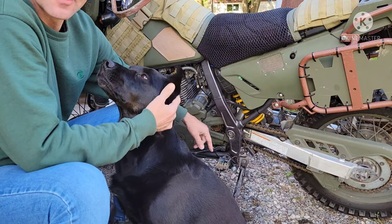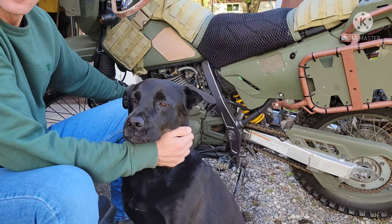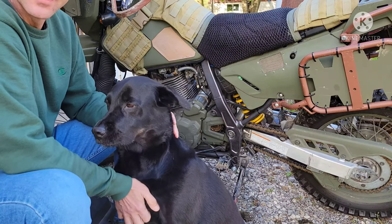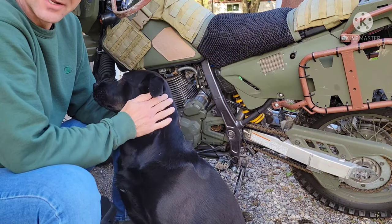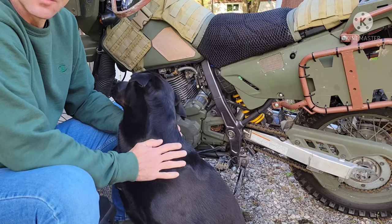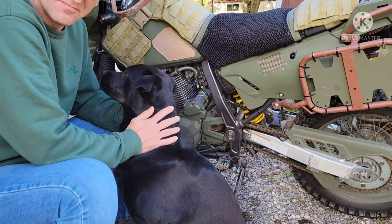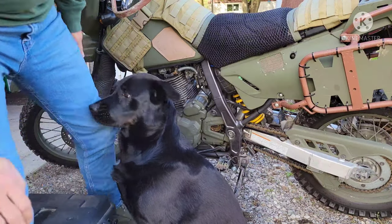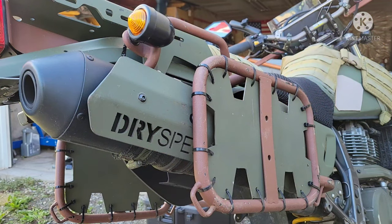There's a retainer seal piece in here — it's like a $15 part and it can save your bike, so I got that. Over here this is the stock exhaust — when I ground out that really big weld on the inside, it was constricting the flow quite a lot, so that's been ground out. That's a cheap way to improve your horsepower. On the other side it's got an FMF Power Core exhaust mounted to it.